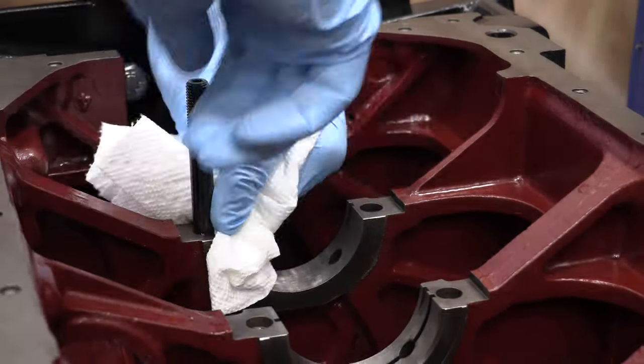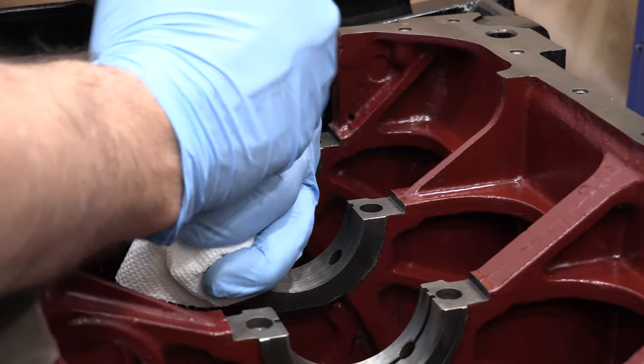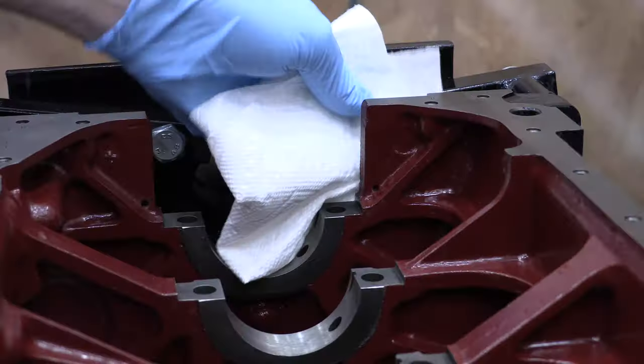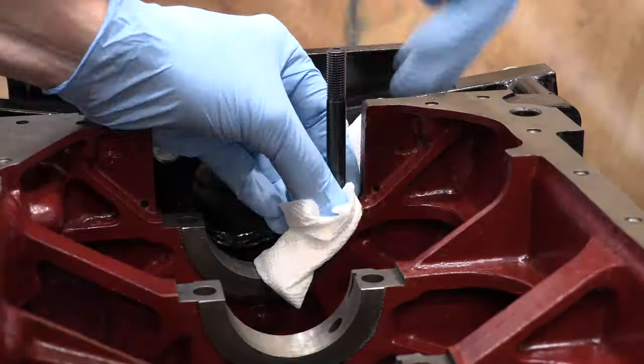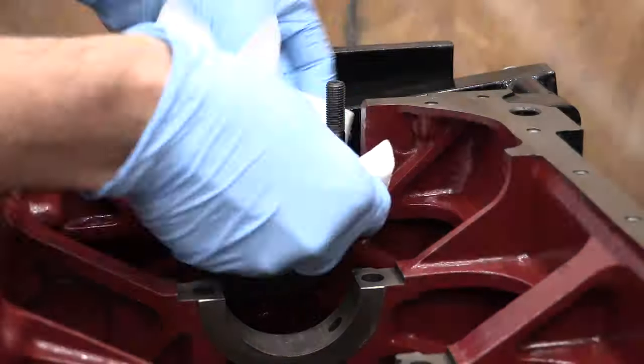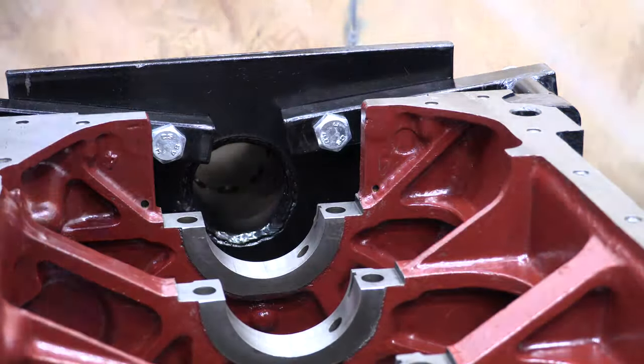Basically, the stud is a hand-threaded pump. This stud shoves all the solvent from the inside out, washing the entire length of the threads. You'll see the color of this funk on those white towels briefly. Sorry it's not very easy to see because I have to catch all of the solvent in the towels or else it'll immediately strip the finish.